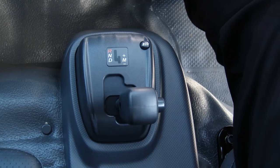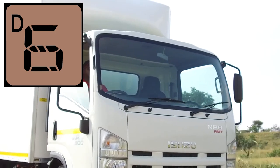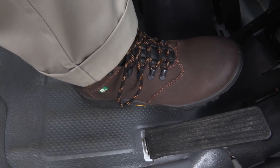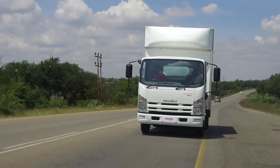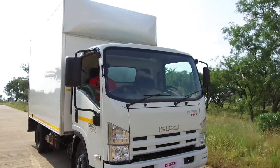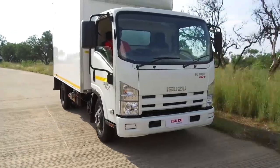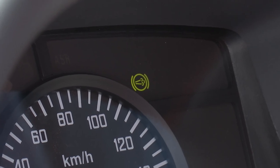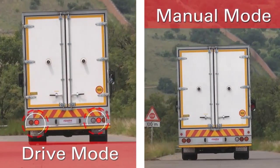Manual mode should also be used when driving downhill. If you drive downhill in drive mode, the vehicle will automatically select the high-speed gear. In top gear, slowing the truck down would require excessive use of the foundation brakes. Frequent use of foundation brakes leads to increased brake maintenance and can cause overheating of brake linings leading to brake fade, which increases accident risks. By driving in manual mode, you can drive at low gear speed, maximizing the power of engine brakes. By also using the exhaust brake, you can increase the total brake force of the vehicle. Using manual mode in downhill areas decreases the use of foundation brakes and optimizes safe and fuel-efficient driving.